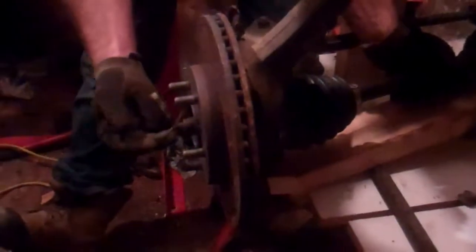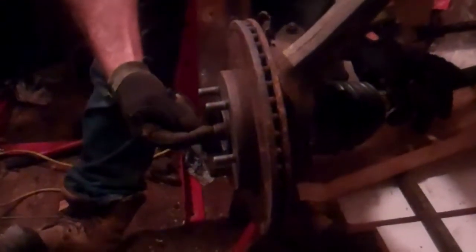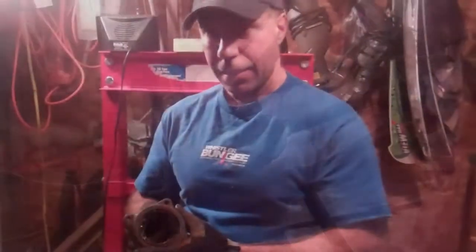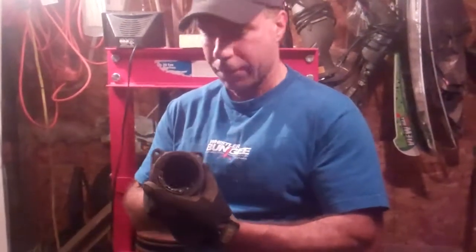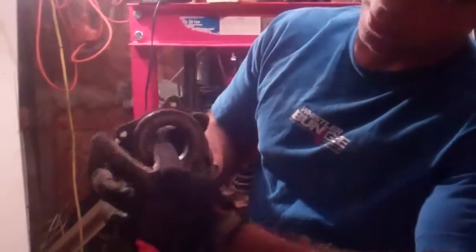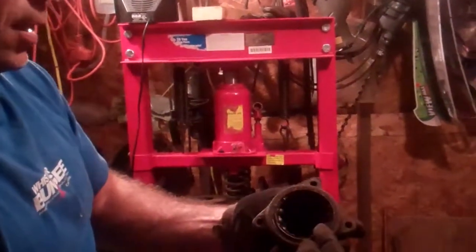Out here is the rotor, and we can see the end of our driveshaft right there. So that's spinning within this bearing. Here is a bearing that I knocked apart for the purposes of this video so we can see what's happening. I put my fingers in and I'm spinning this around — that's the idea of a bearing. The driveshaft comes through there, the spline shaft goes through and it's bolted on the other side. If you look in there you can actually see the balls all greased up, and that's how it's able to spin.